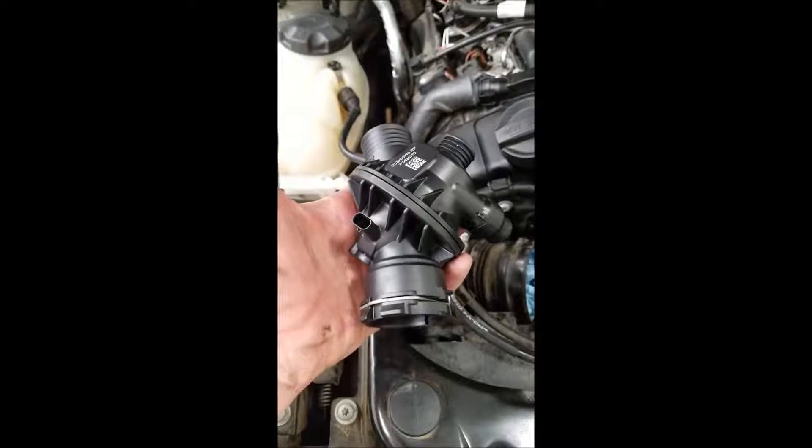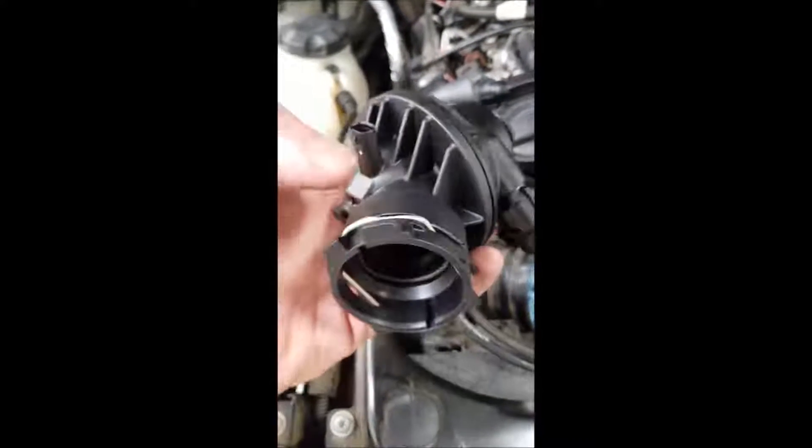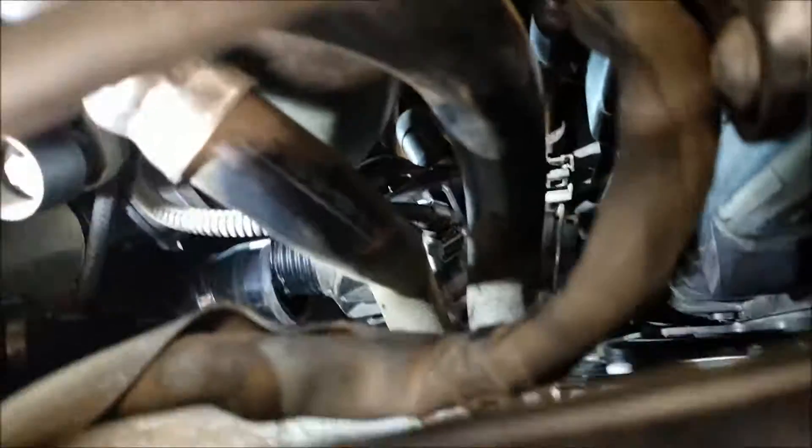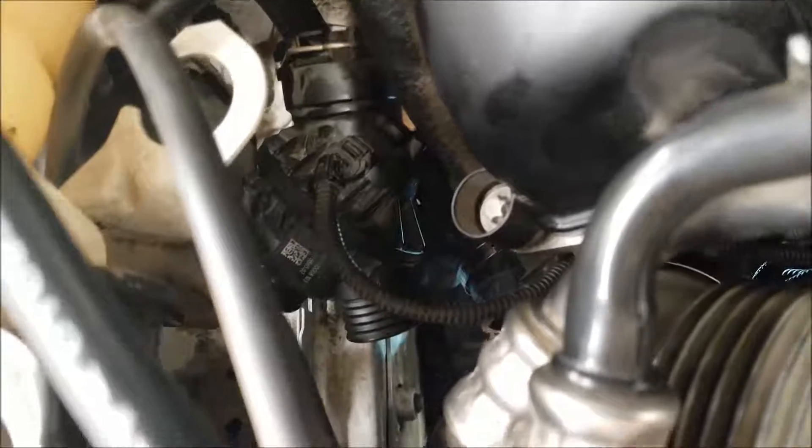This quick disconnect, I've oriented this the same as it is in the car installed, so it's just going to pull straight up this little wire here. I managed to use a hook tool to get down onto that quick disconnect you cannot see at all. You can see the little wire down there — it needs to be pulled straight up toward the top. So I'm going to try to pull that thermostat back away from the radiator housing. I had to take a big screwdriver and kind of lever it down, brace it on one of these mounting screws, and then lever it toward the back of the car to get it to pop off as I wiggled it with my other hand. I was able to maneuver off all those hoses and kind of get the thermostat up here. The only thing left to come off is this electrical plug — a screwdriver to lift up the little tab.